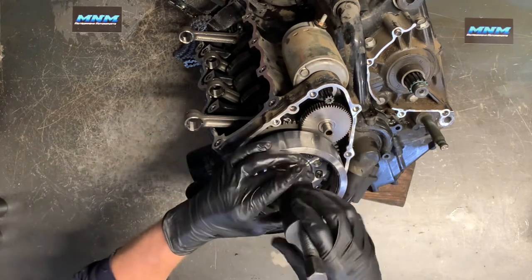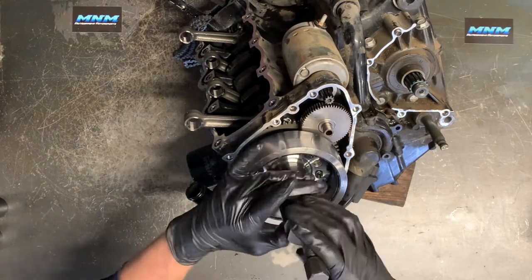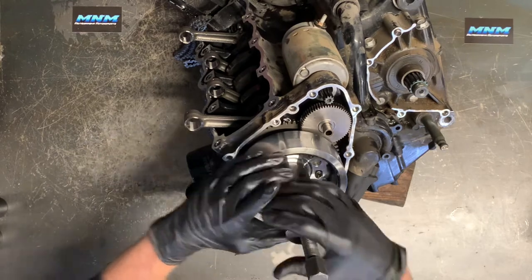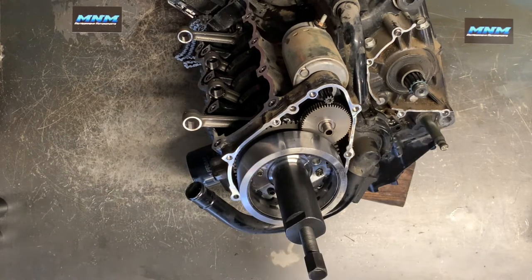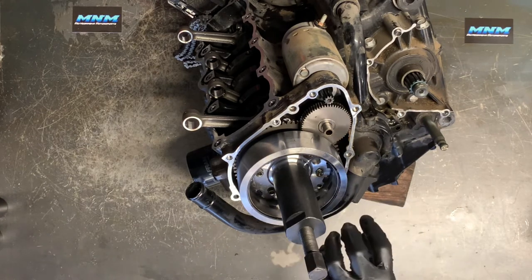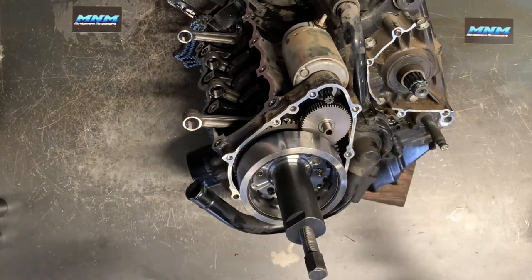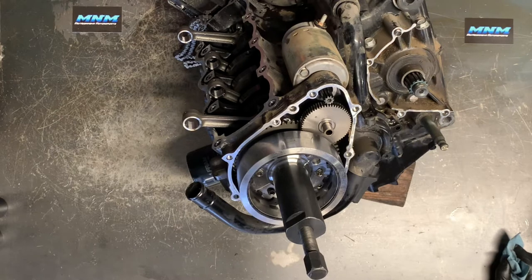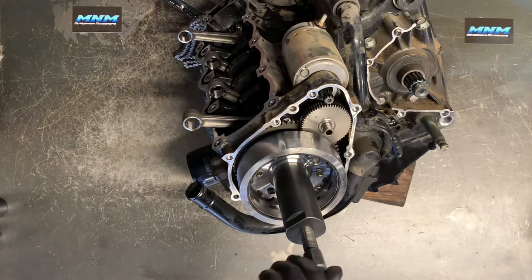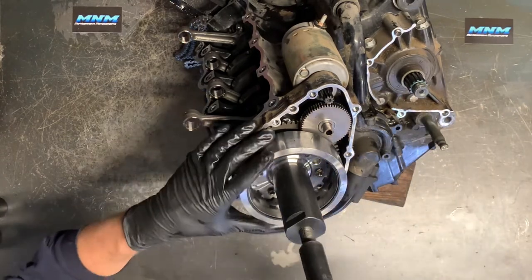You're going to take this puller, screw it onto your flywheel, make sure you've got it going in the right direction, and make sure you're not cross-threading anything — that defeats the purpose of using a special tool. I'm curious if anyone has found a better way to remove a flywheel from a motorcycle, but there's not a better way that's going to allow you to keep your flywheel and your crankcase. You could get some pry bars in and go hulk mode, but you're not going to salvage your flywheel or crankcase. We're going to run that bolt down in there with a 19 millimeter socket.